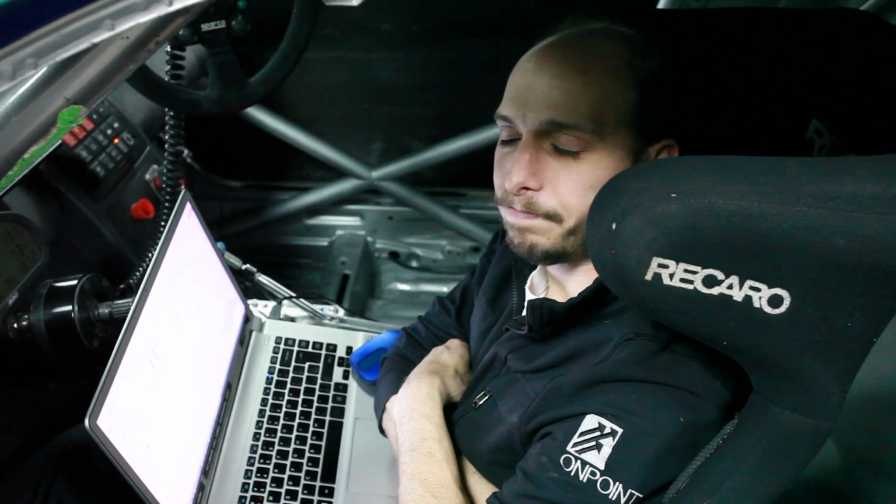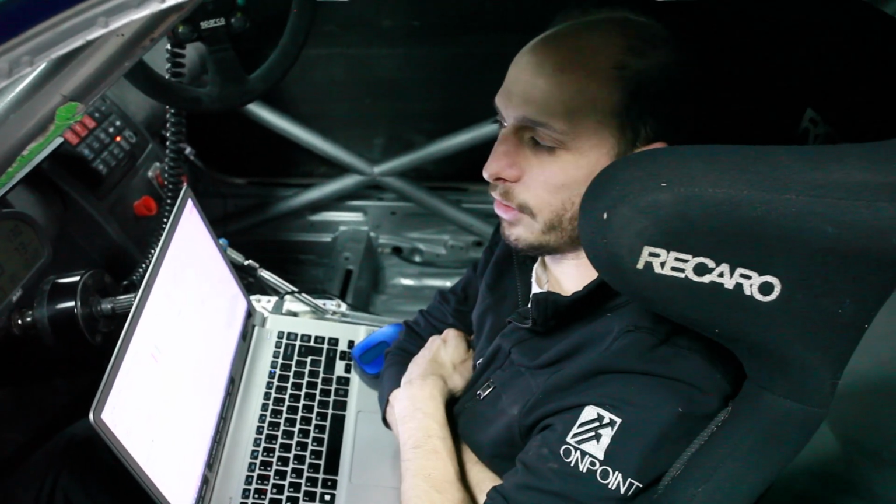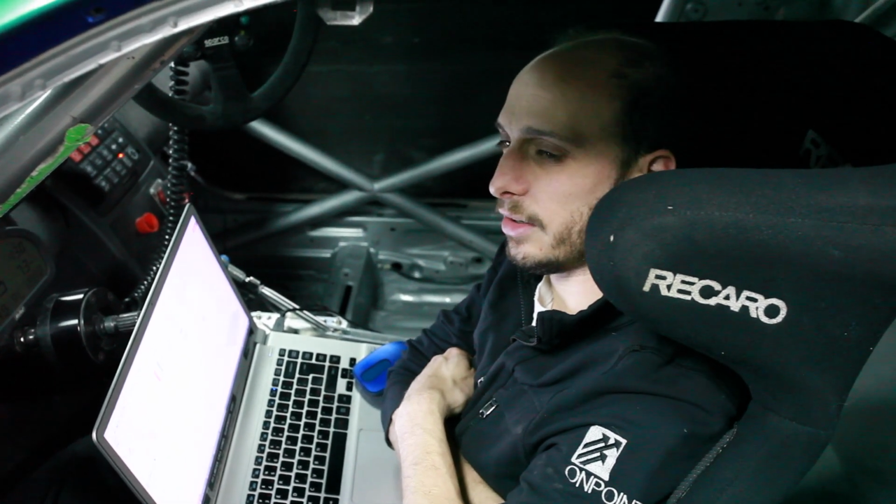Okay. Yeah, I mean, that's a good point. Obviously, you want to get beyond the 420 mark, don't you? And you think you need the bigger TBs for that. Yeah, the 53.5 throttles that we sell are perfect for this engine setup. We're shooting for a little bit more in the future, so the 57s were an investment into our future, kind of. Gotcha. So it's time to develop the motor more. We're not there yet. Yeah.